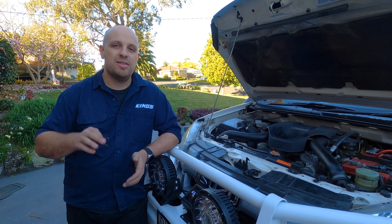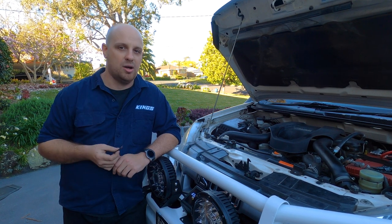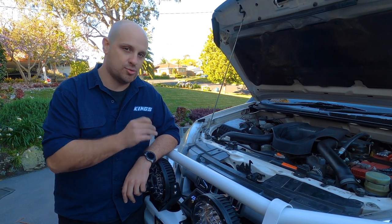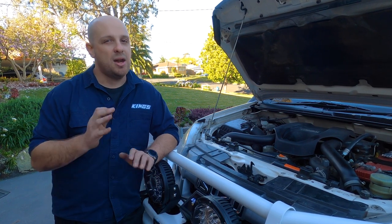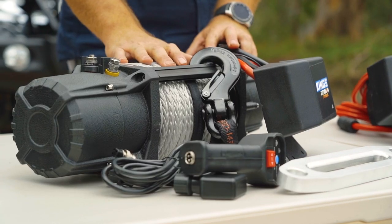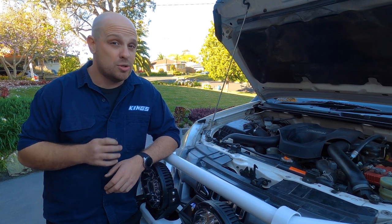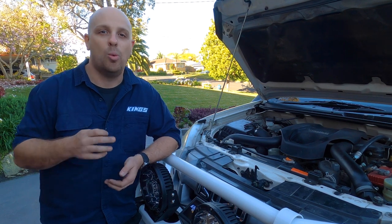If that didn't get your winch working, the next step is to grab yourself a paper clip or a short run of electrical wire. We're going to use it to momentarily bridge out a couple of the pins on the plug on the side of the control box, so we can diagnose whether the solenoids within the control box are working. A word of warning: this will work for Dominator X and Dominator Xtreme winches using these exact instructions, but I can't guarantee it'll work for every brand of winch. If you're going to do it on a different brand, make sure you consult the owner's manual first for the wiring diagram.